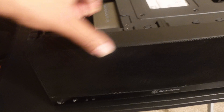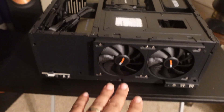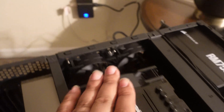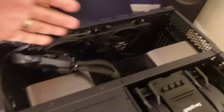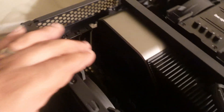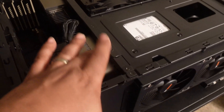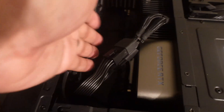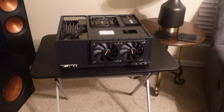From the front you've also got some air going there too. There are two mechanical hard drives here, air is being pushed in one direction, smooth and straight. The 280 millimeter fans are exhausting, we've got two 120 millimeter fans bringing air right into this GPU. This is a Founder's Edition card — it has a fan on the front that spins and blows air constantly on the card, and another fan on the side that can suck in any air seeping through. I think this is a really great thermal situation.